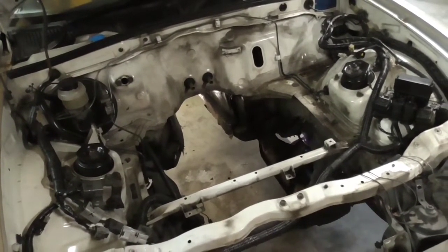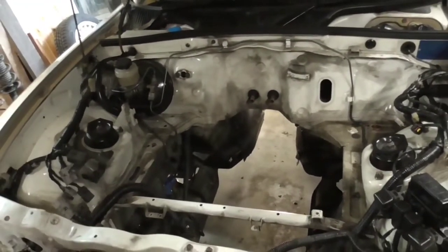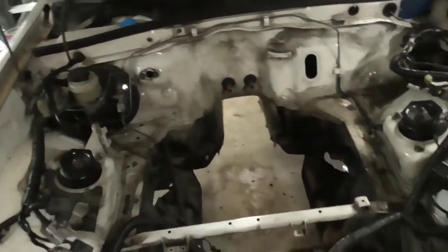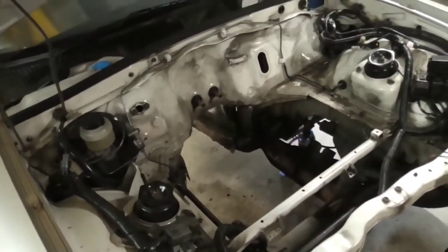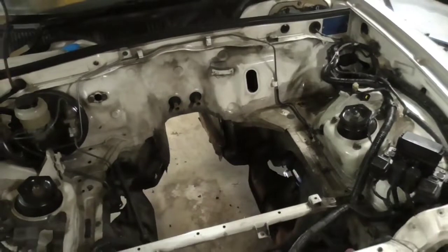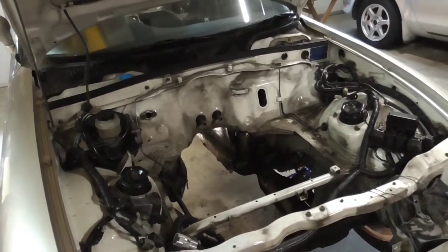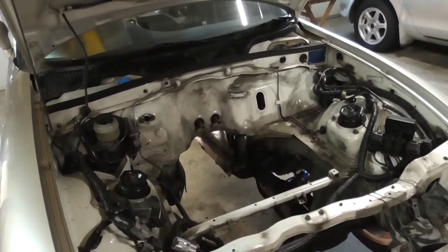The cooling system is actually going to be very simple. Everything's going to be air cooled with the exception of the controller. The controller needs cooling, so I bought a chill plate that comes as an option, and then we're going to have a little cooling system that we'll have totally controlled. We'll be able to program that too, and set the exact temperature that we want the water pump, and then the fan, to turn on.